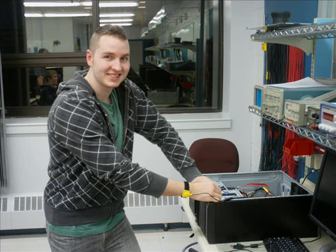With the case open, this is a good time to talk about electrostatic discharge. Even static shocks that you can't actually feel can damage the delicate components that you'll find inside a computer. Damage caused by electrostatic discharge is invisible and permanent. To help prevent electrostatic discharge, wear an anti-static bracelet and attach the grounding clip to the frame of your computer case. Also, avoid working on carpet if you can, especially during the winter.